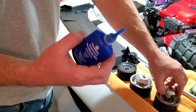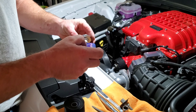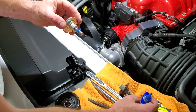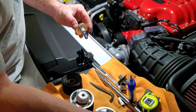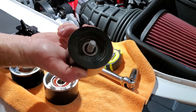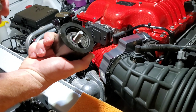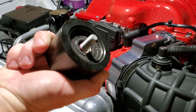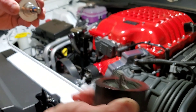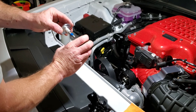One crucial step you will not want to miss: make sure you put blue Loctite on it — both bolts, doesn't have to be a lot, just enough to keep it in there. Side note: the factory had red Loctite on it. So do not skip the step of putting Loctite back on the new billet pulleys.